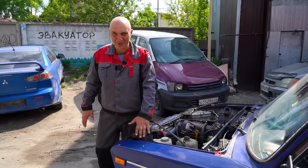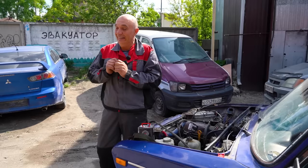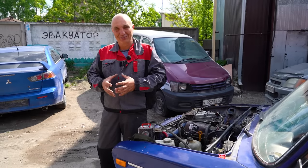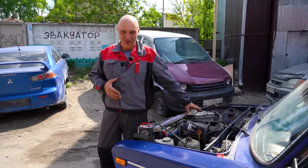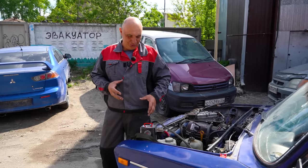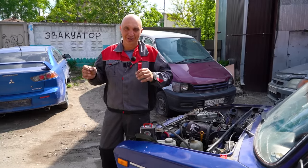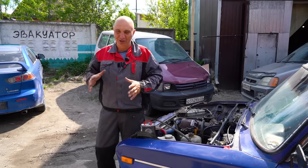So here's the situation, guys. On that nitromethane fuel, and this was super interesting, the engine was literally whispering. It was working perfectly, but it wasn't able to rev. With the carburetor not being designed to provide enough fuel for the engine to run on this stuff, we don't know if it needs more of it or less. It's not easy to tune a carburetor for this. Still, it ran so softly. And even in the moments when I was feeding more in there and getting the revs up, it still ran very well. It was so nice, man.